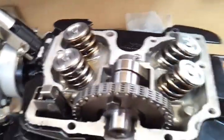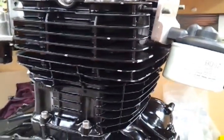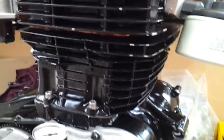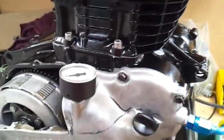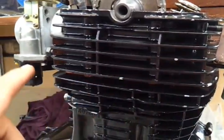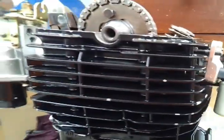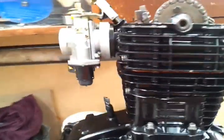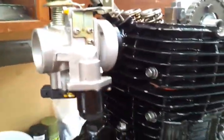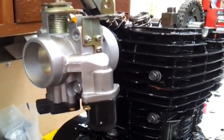What I've done with this engine, we've modified it somewhat. It's now got a 591cc kit in it. We've got a Carrillo rod, heavy-duty main bearings. It's an FT500 flat-track racer cylinder head, been ridiculously ported. It's got some big, big ports in there now, so it's going to eat a lot of fuel, a lot of air, so to account for that, we've changed the FI.